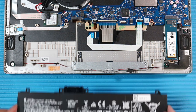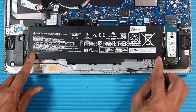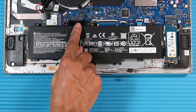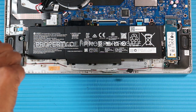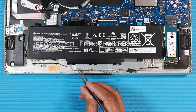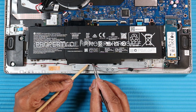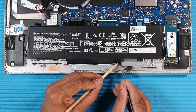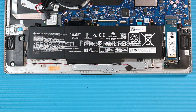Replacement. Place the battery onto the battery connector and alignment pins on the top cover. Press down on the battery connector to establish a connection with the battery connector on the system board. Replace the five P1 Phillips-head screws that secure the battery to the top cover. Route the speaker cable through its routing channel along the bottom edge of the battery. Smooth over the adhesive that secures the speaker cable to the touchpad bracket.